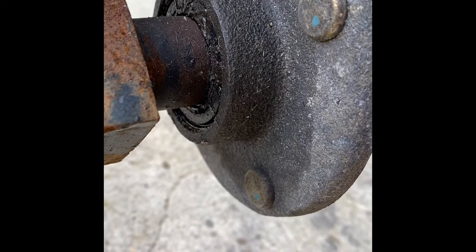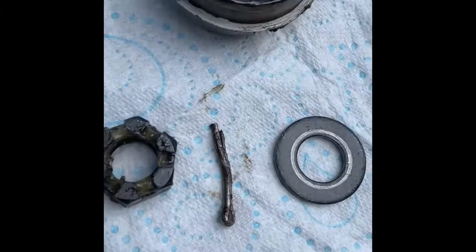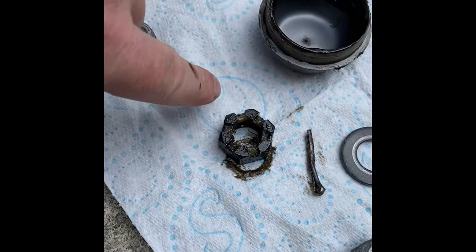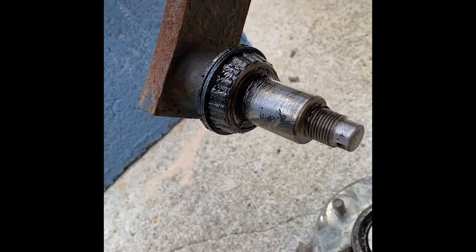Or if it's like the other side was, it'll be a bit corroded onto the spindle and you'll have to beat it off with a chisel and a lump hammer. There's your split pin and the castle nut — it's got little turrets in it, and the split pin goes through the axle and lies in the recess of the castle nut holding it on. The hub came off with the outer bearing in it; the inner bearing stayed put.